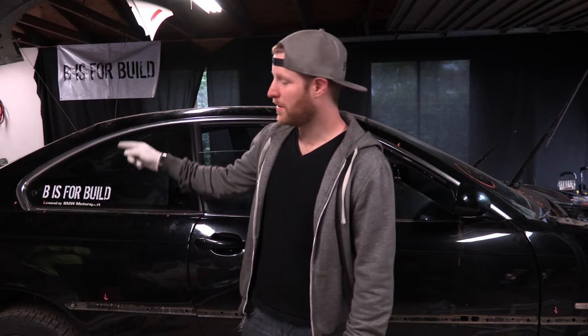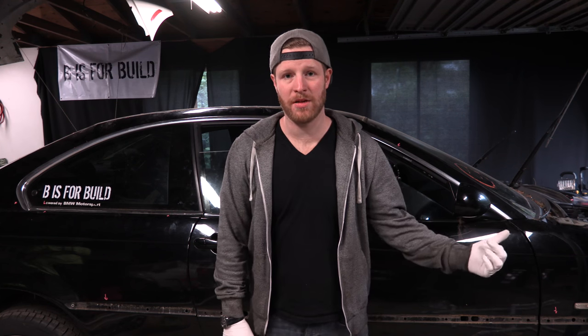I'm Chris. We are back in the shop working on our E46 budget BMW. If you remember in the last episode, we blew a hole in our radiator, so Eric and I ran down to the junkyard, grabbed a new radiator. We are going to mount that up, and then we're going to hack our thermostat in the front so it will always be open so we can get maximum flow and hopefully not overheat our engine.